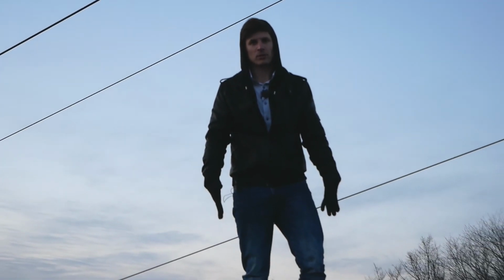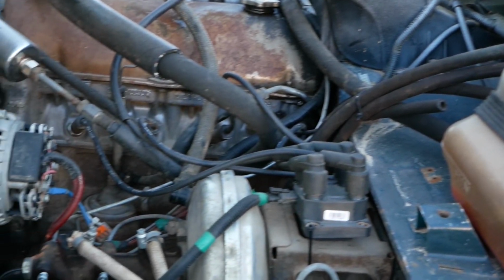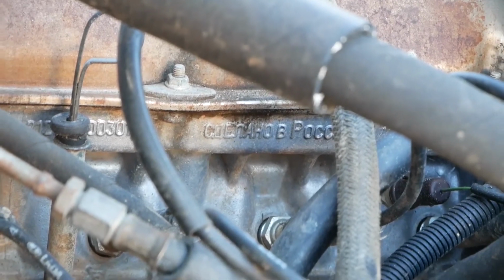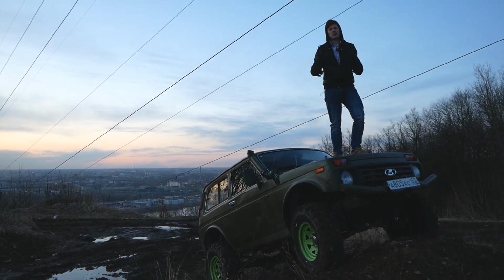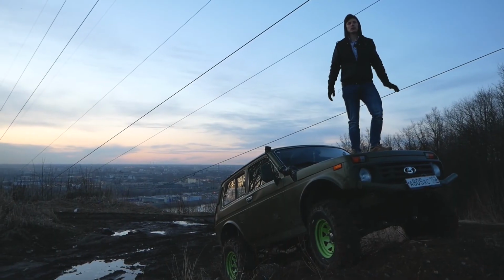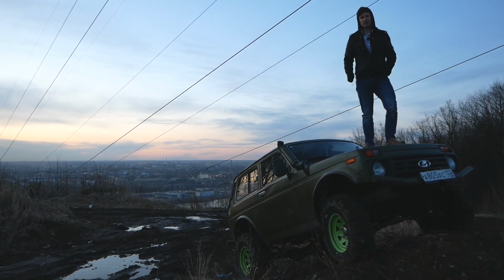Right below me is the engine, which was converted from the stock 1.7 liters to 1.9 liters. 84 mm pistons on 84 mm crankshaft were installed. Intake channels were polished. Lightweight T-shape valves and a lower camshaft with longer opening phase were installed. The alternator was lifted to the top of the engine and changed to a more powerful 135 amps. The main computer was changed to Yanvar 7.1 or January 7.1 if you want, which can be updated online. Other electrics is stock.